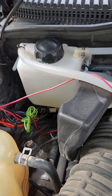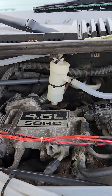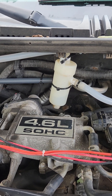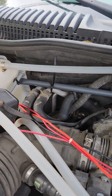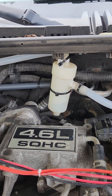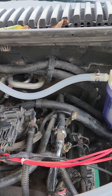Here's a reservoir. The reservoir goes across the back to a bubbler so that the actual electrolyte doesn't end up inside the engine. You can see there's a little level there, so when you're driving along and it's rocking and bouncing, the bubbler collects anything that got shot into this one hose here from the bouncing of a full reservoir, and the bubbles just allow the hydrogen to flow through to the next stage, which is called a dryer.